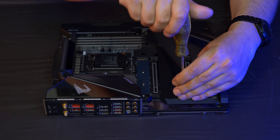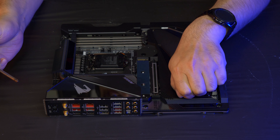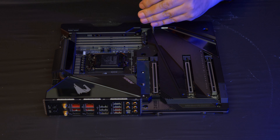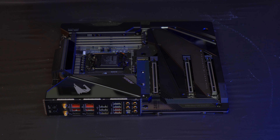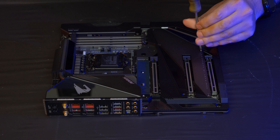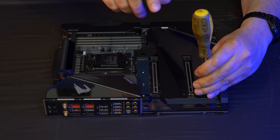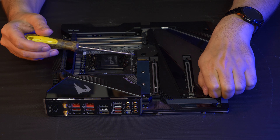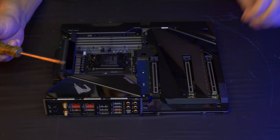On a motherboard with this kind of aesthetic you'll have to unscrew to get to the M.2 slots, which are the real storage value on the board. This motherboard has three M.2 slots. For high-end NVMe storage and direct storage in Windows 11, you want to use M.2 because M.2 supports NVMe while SATA does not. SATA is limited to 6 Gbps; PCIe Gen 3 M.2 is 32 Gbps, and Gen 4 is 64 Gbps — a huge differential.